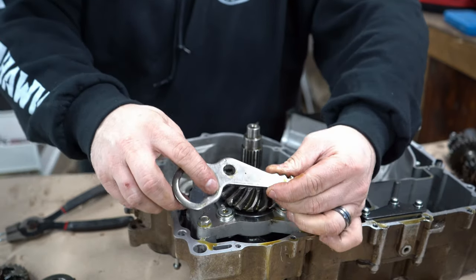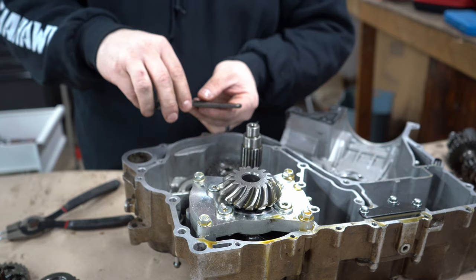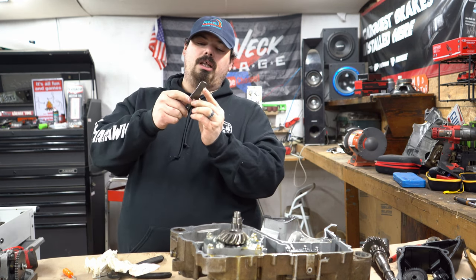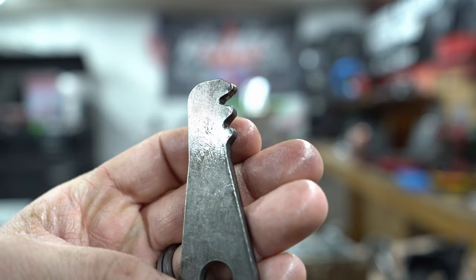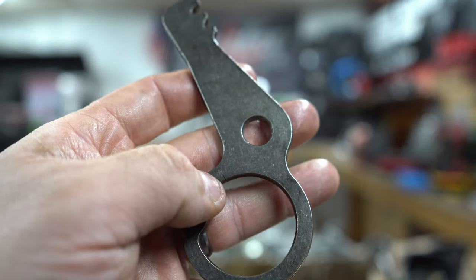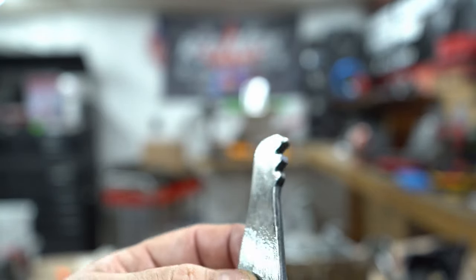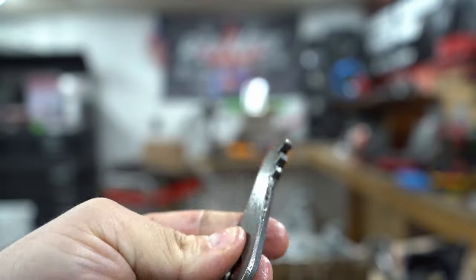There it is — there's the failed part right there, I can feel it. This is your parking pawl. This is what slows your motor down into park and it's broke. If you're having a hard time with your machine going into park, this is what this part does — it shifts over and shoves it into park, locking the pawl up against some gears. You see those teeth right there? This one is all kinds of janked up and so is this one. This parking pawl needs replaced — that's the whole problem. There's also a hairline fracture right there where my thumb is. This is exactly why you can't put your machine in park. All they had to do was make this a beefier part — this is just crappy stamped-out steel.